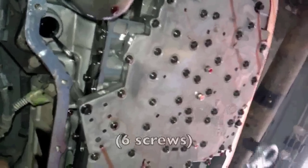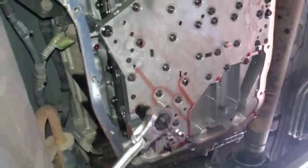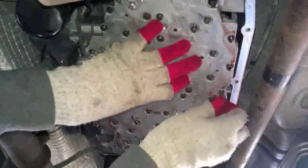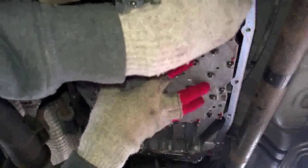The bolts to get your valve body off are not T25s — a lot of the other bolts are, but you're only worried about six screws right here. They're 5/16ths, just like the same size as the ones you used to get the pan off. I've got my last few bolts here to get out — I've got these three. Once you get them loosened with the bit, they're pretty easy to crank out.